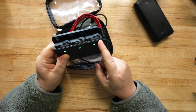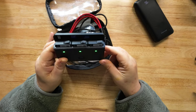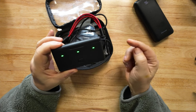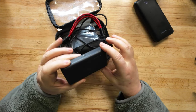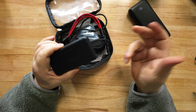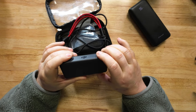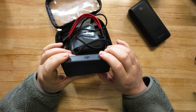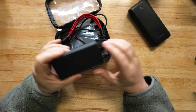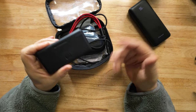One battery will do almost one hour of 4K 30fps, so with four batteries I get 4 hours. This charger is also designed for quick charging. Let's say all my batteries are done after my 4 hours and I still want to record more. All I have to do is plug it into my bigger battery here, and within about 20 to 25 minutes, my batteries are up to 80% capacity. Put them in for about half an hour and they're all fully charged. So I'm really not waiting long to get ready and go again. I can be charging these while I'm eating at night and have them ready for the next morning.